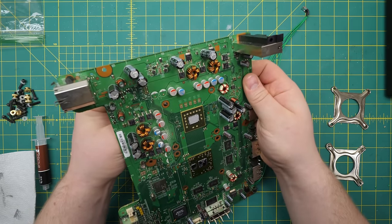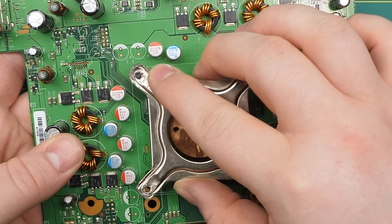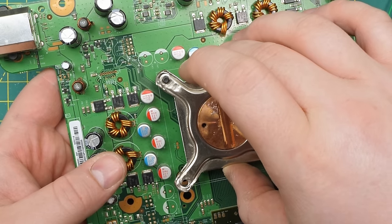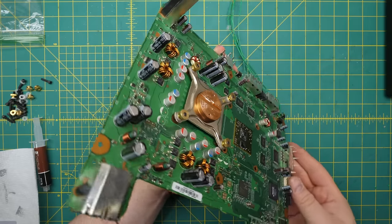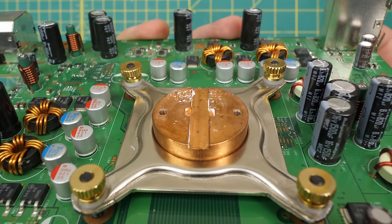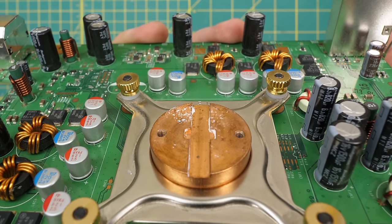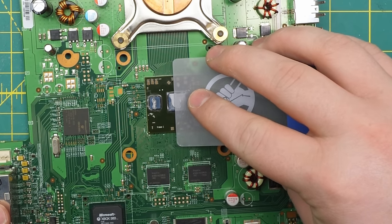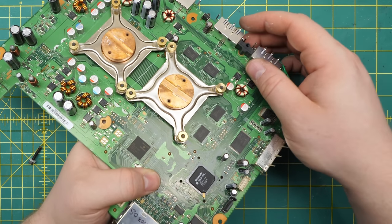With that done, we're ready to start actually assembling this thing. I popped a screw through the bottom, set one of the slugs on top of the CPU, dropped the bracket on top — and it didn't fit. It seems like the edges of the screw hole got pushed in by my amateur blacksmithing, so it's too small now. I chucked up a diamond burr in my Dremel tool, rounded the holes out again, and now the bolts fit no problem. On my second attempt, everything went together swimmingly. Since this is not a manufacturer-intended design, there's nothing to help me ensure the pressure on the die is even. But since all the bolts are the same length, I can use the exposed threads to determine relative torque — I spun the nuts back and forth till I saw even stick out on all the bolts. The GPU was more the same deal, except I had to grease up two dies instead of one. Put the bolts through, put the thing on, put the nuts on — a couple minutes later, sinks are on the new board, ready to go.